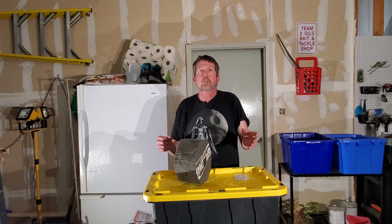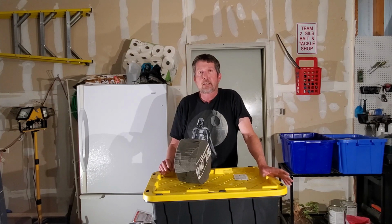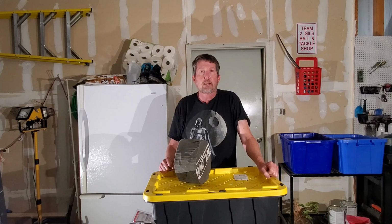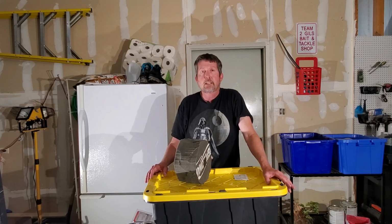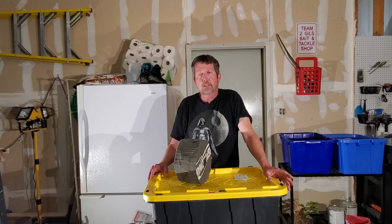What that's going to do is give you a little bit more stability at those high speeds. Your bump steer is going to go away. It's going to be a lot better to ride, probably a lot more enjoyable. You're still going to be able to turn. You're just not going to be able to get in and out of tight stuff super quick. So again, everything's a trade-off, but typically you're going to want positive caster if you're doing a lot of high-speed stuff.